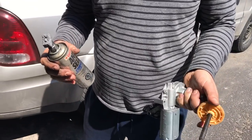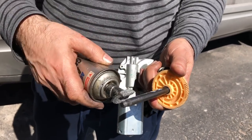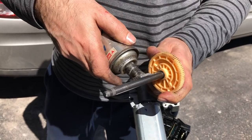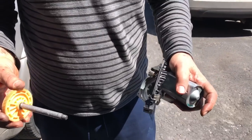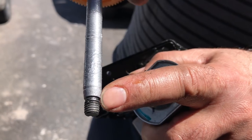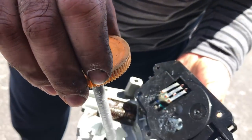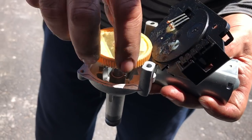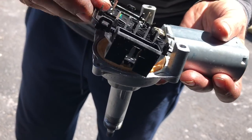I've got some anti-seize compound and I've finished cleaning the inside of the shaft — it's all good. I've sanded this down and I'm going to put some anti-seize compound all on here. The nice thing about anti-seize compound is it does not get thick over time, and it also prevents metals from corroding together. Hopefully this will be a good long-term solution for this. You're going to notice this little spline here — I've also put some anti-seize compound on there. That spline is where the rear wiper fits, and that usually seizes onto the wiper, so hopefully that'll prevent that in the future as well. I'm going to slide this right into the shaft — you can see I've got anti-seize compound all over it. Look at that — nice and easy, it's going in no problem at all. And once we get this all together, we should have a rear wiper again.